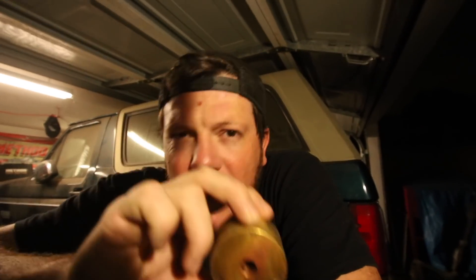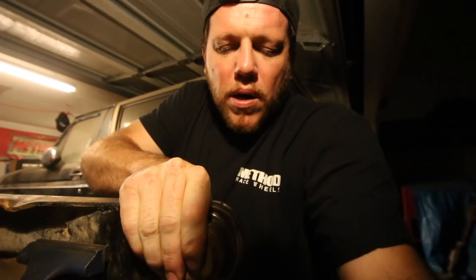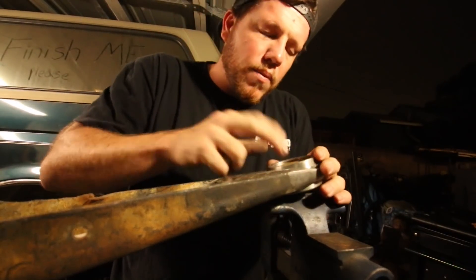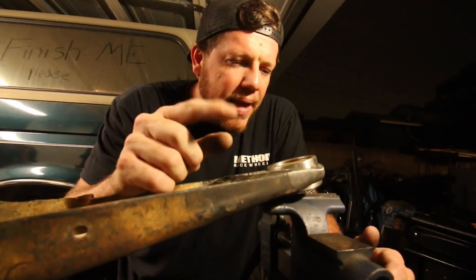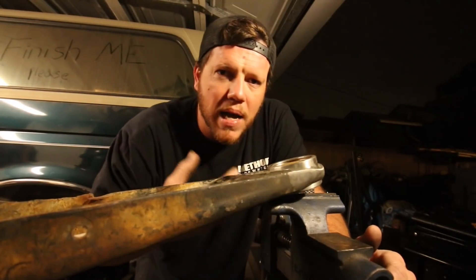What you're going to do now is replace this guy — your slug. I purchased this from CarTech. A company called Next Gen Off-Road sells them, and you can also purchase them through Off-Road Warehouse. So you're going to take that slug and fit it right in your uniball cup. Nice and tidy in there. The last time I did this I put anti-seize on it, but it just kind of smoked a lot. I don't think the brass needs anti-seize. If you were using an old uniball to do this I might suggest anti-seize, but since I'm using brass, I'm not going to.